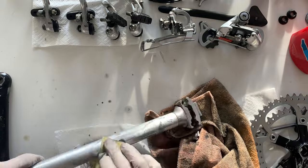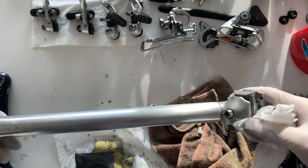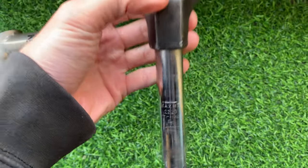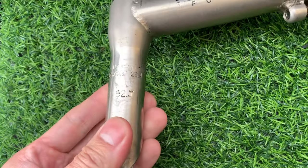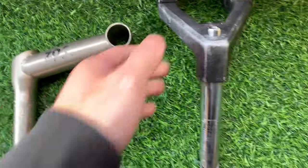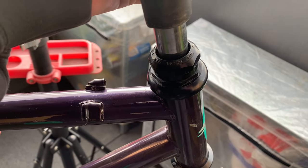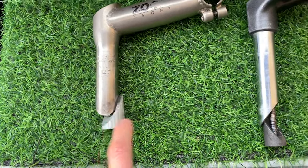There are some deep scratches in this seat post, and I basically just used 800 and 600 wet and dry to clean it up. It took a while, but I ended up getting most of the scratches out. The next issue I wanted to fix was I want to put this stem on my bike, but usually a 25.4 stem fits and the stem I have is 22.2. So I'm going to try to get this to fit in my frame. You can see when I put it in, it's going to be loose of course — we're going to work out what we can do to get it nice and snug in there.